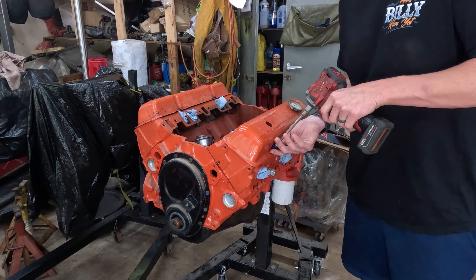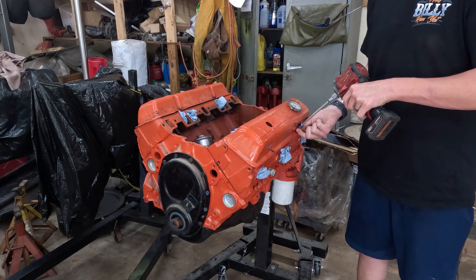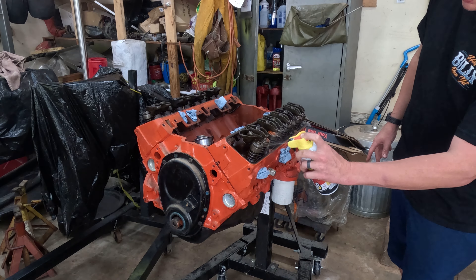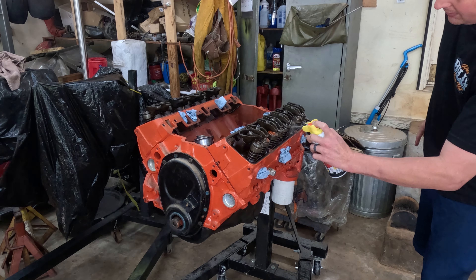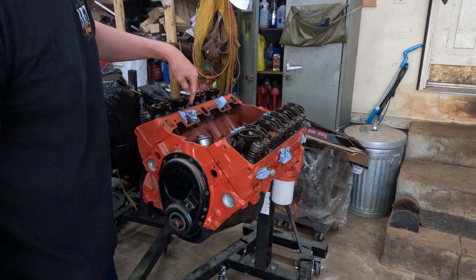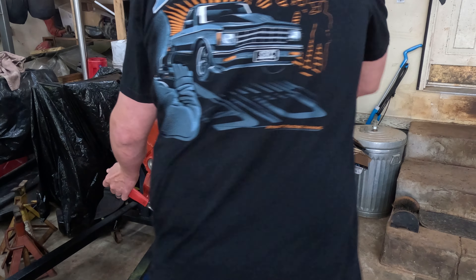Alright, so let's knock off these - these are pretty much 7/16ths, I'm pretty sure. Yeah, 7/16th. Before I start turning anything over, before we put the push rods in, I want to get everything the best chance for all these valves and valve seals. What you do is put it on the crank. One thing we don't have to worry about is it sucking into our intake - the rag is down - because we'll have no push rods, so all the valves should be closed. See how tight that is?